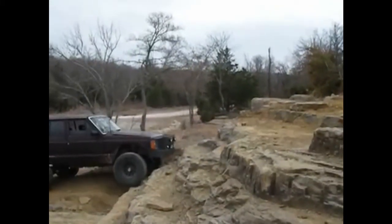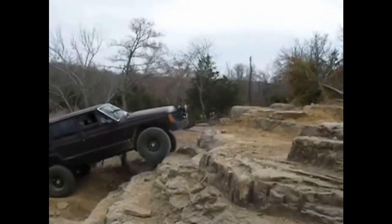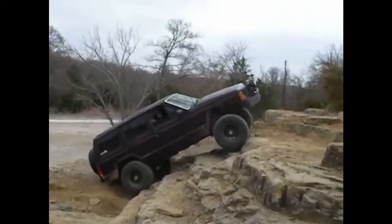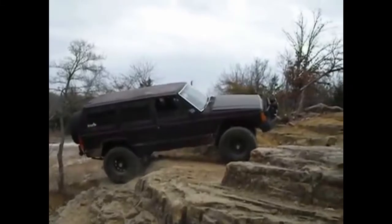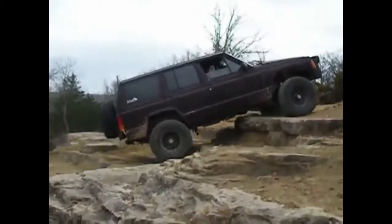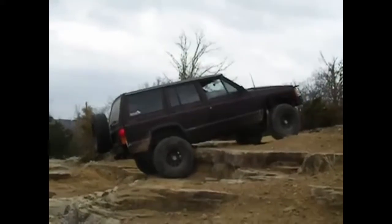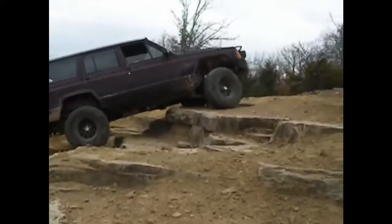And at one point I got out to drive it, and it didn't have any guts. It was just running like crap. And then next time I got in it to drive it, it died. It wouldn't run anymore. And to be quite honest, I didn't really know at the time what the problem was. It took me a little while to think about it and actually put two and two together that it had just sat so long that the gas was bad, and it was just trying to run off varnish. And recently I finally decided to make the commitment to get it back running again.